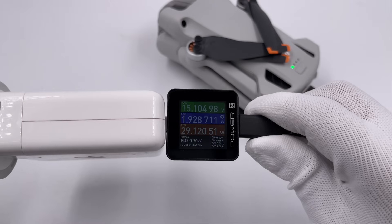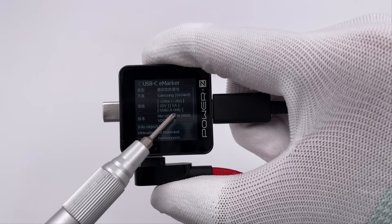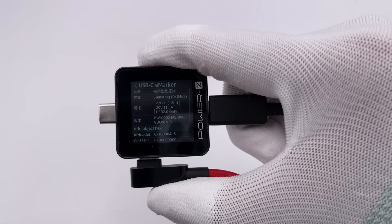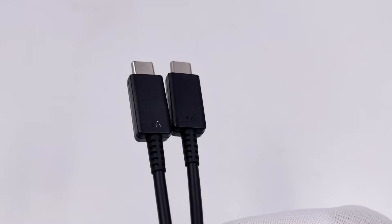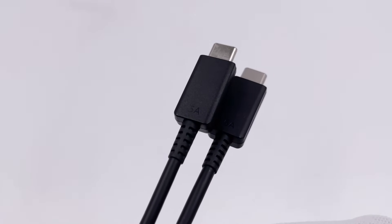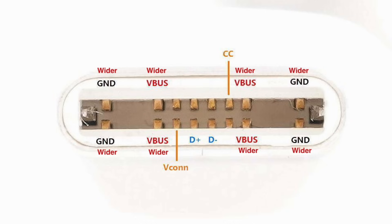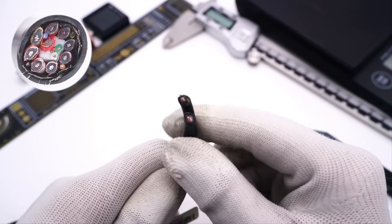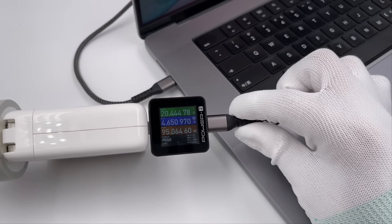Higher power is needed if you're using a PD charger to charge laptops. Compared with the 3A cable, the 5A cable has higher standards in all aspects. Its maximum power can be up to 100W based on PD 3.0. 5A is generally marked on the packaging and the connector for easy identification. It must be equipped with a 5A eMarker chip to facilitate the handshaking so the current can break through the limit of 3A. The USB-C connector of the 5A cable will have thicker plated gold, wider pins, and thicker wires inside. Cotton thread and powder are added to improve flexibility. The 100W fast charging is usually used for flagship devices, so the price will be higher than the 3A cable.